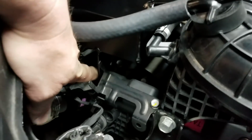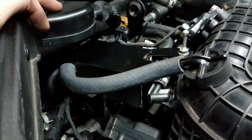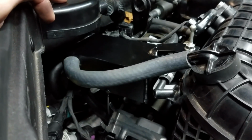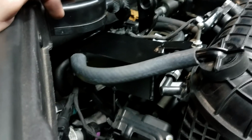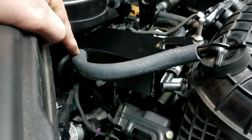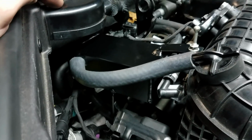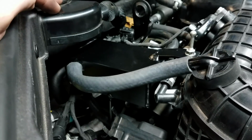The PCV valve, again, runs through, goes over the top. PCV valve's down here on the bottom of the valve cover. The reason you don't want boost on your PCV valve is that it's not an engineering masterpiece. It's a mass-produced ball and check valve assembly with a little spring under it. It cannot stop boost. It has a small leak, so in order to avoid any boost getting blown past the PCV valve, we put a check valve right here. We use Anver check valves. They're fantastic check valves. They have a very low cracking pressure and they operate phenomenally. Used them for the last 15 years.